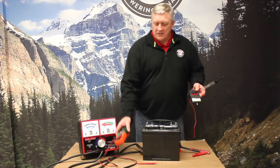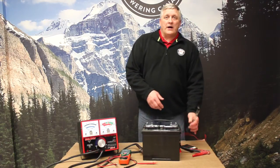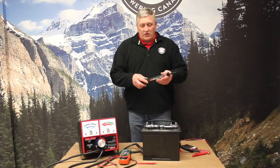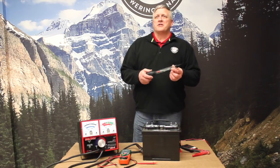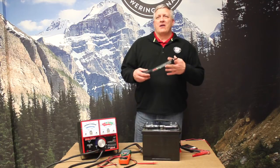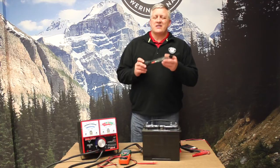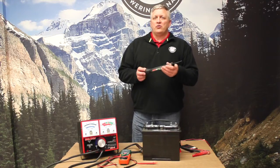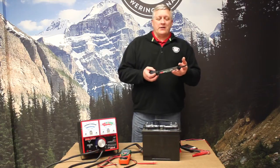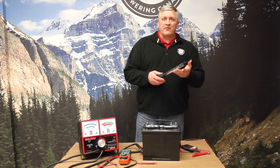Here we have a digital voltmeter that measures DC and AC — obviously batteries are DC voltage. So test number one is the battery hydrometer. The nice thing about a hydrometer is they're always 100% accurate. If you've got a bank of deep cycle batteries for off-grid, cottage, or boat use, this is really the tool you need to determine state of charge. It's very inexpensive — under ten dollars — and they're fragile, but perfect for determining state of charge with flooded batteries.